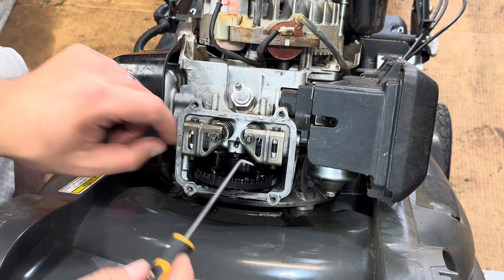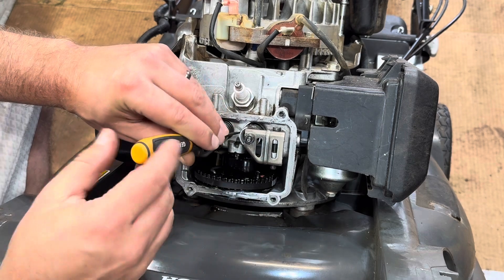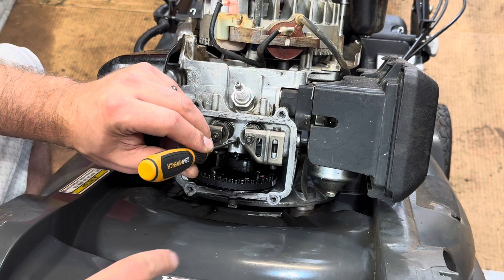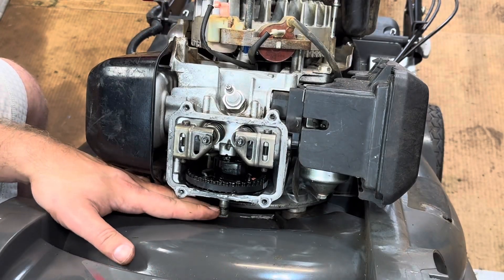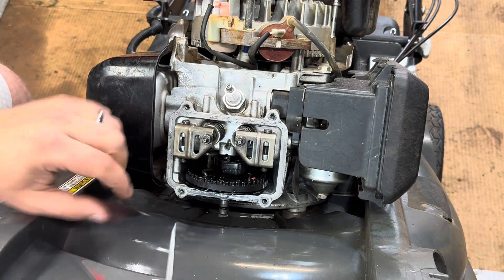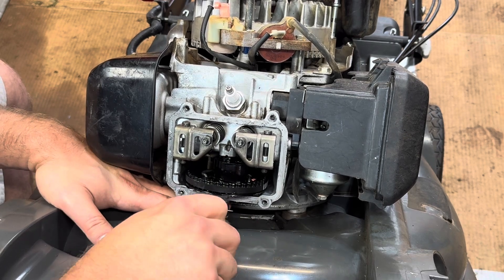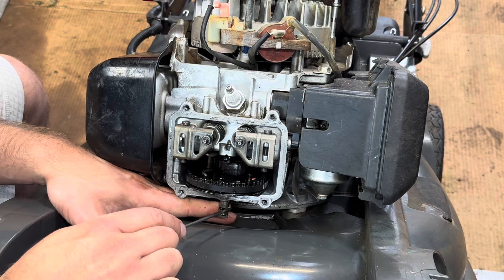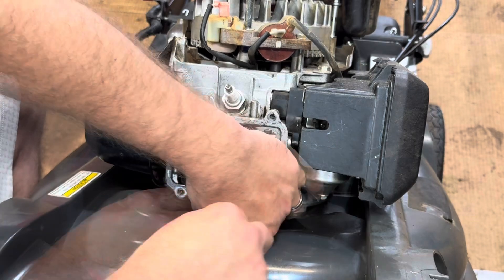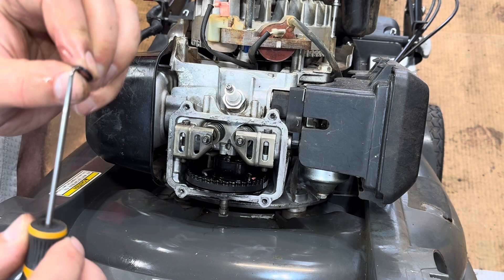Right in here is the top of the pin that the camshaft rides on. We're going to push down on that and you'll see it pop out the bottom just like that. We don't have to get it all the way out — just far enough to get the o-ring off. You can feel all the oil that's gotten below the o-ring. We're going to come in with a little pick — kind of hard to see with my finger here — get below that and work it around.